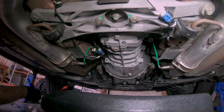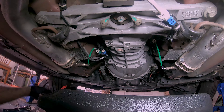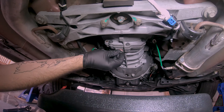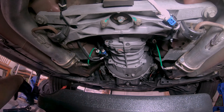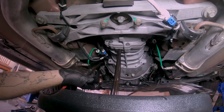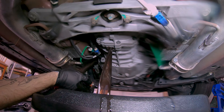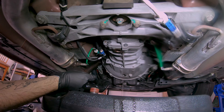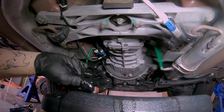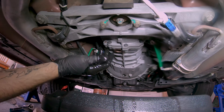Same story down here — we have our fill plug out, so it's ready to go. I'm just going to take the drain plug, plug it in there, and back this out. Make sure you have your drain pan ready. It's only going to be about 3.2 quarts of liquid, so unless you're using a teacup or a shot glass, you should have no issue. And that is not how transmission fluid should look — it came out with extreme vengeance and sprayed absolutely everywhere. That's why you always wear eye protection, folks. Just be careful when doing this and make sure you're wearing gloves and eye protection. Now I'm going to go clean this corrosive liquid off my GoPro.